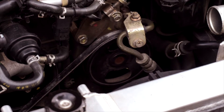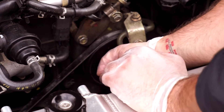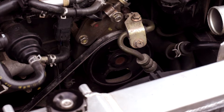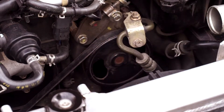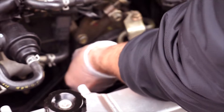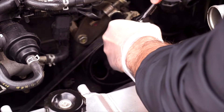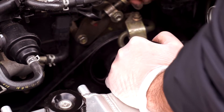What we need to do first is crank the starter just a couple of times to expose the bolt that's behind this pulley. We want to make sure the opening meets with the bolt so we can actually unscrew it. So we're going to start with that bolt behind the pulley — that bolt is a 9/16. We don't want to undo the bolt completely, we just want to loosen it. Then we're going to undo this bolt right here, and that is a half inch.